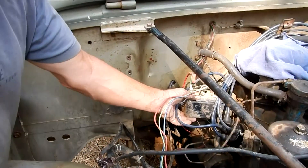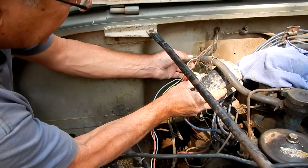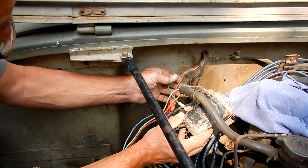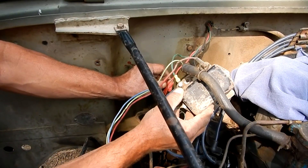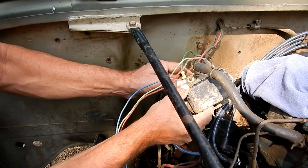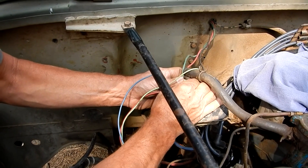The person before me had a set of gauges inside, which is what these two wires are going to. This is coming off the battery terminal, and this is returning to the standard wiring to get power into the ignition and the vehicle for lights and all that. I'm going to take off this regulator.